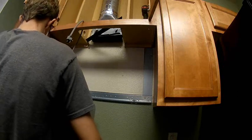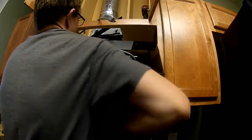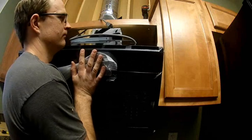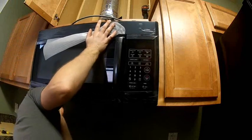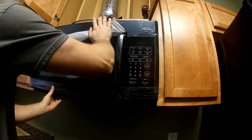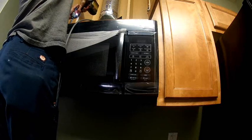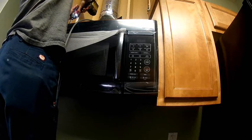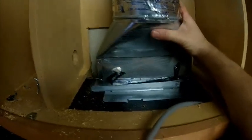With your new microwave in hand, you put the cord up and then you want to kind of hinge the microwave onto that wall mount. You've got to reach around it to make sure they click in — and you'll see here, they clicked in — and then it hinges up. You want to make sure it is fully on that, or the microwave will fall, and that will not be fun. You hinge it up, put it up there, and then re-secure with the two mounting bolts up top, one on either side. Hopefully your holes were correct from your measurements, or you'll need to re-drill them. You can see the two mounting bolts on either side right there.